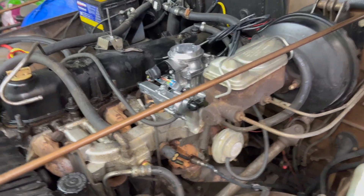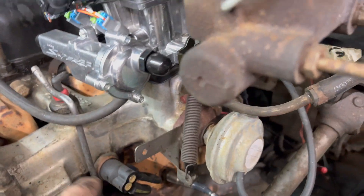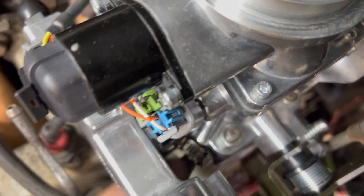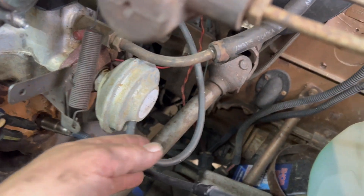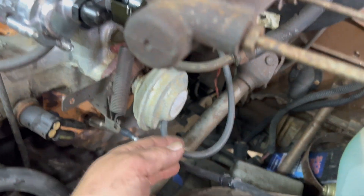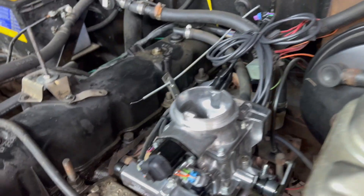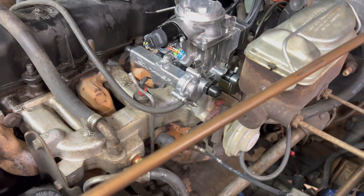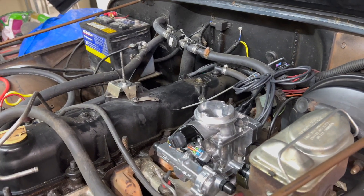I'm not going to plug them into the harness right this moment. I've got all my vacuum lines hooked up - I've got the distributor vacuum advance plugged in right there with a hose clamp on it, I've got my PCV valve plugged in at the back of the base, and then whatever this doohickey is - probably some emissions deal. There were just three things I had to get plugged in there. Now the next thing is to make some electrical connections.